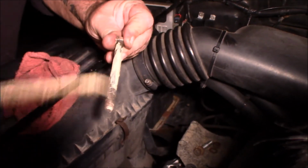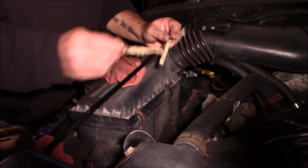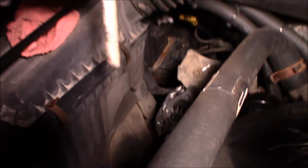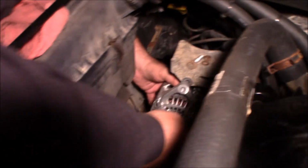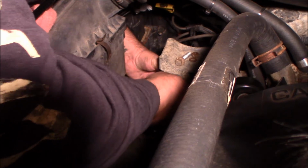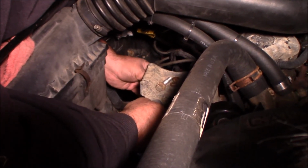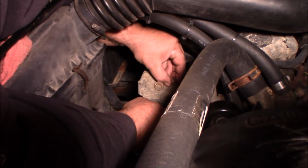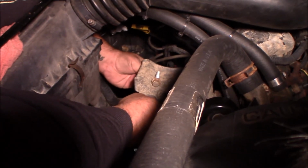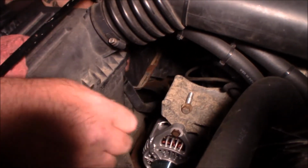and the reason why we use white grease on the top bolt is, those of you who've been watching me for a long time know that line. You know the line, Steve-O? Nope. You don't know the line? Come on, really, Steve-O? I might if you say it. You're going to put some white grease on the bolt. And the reason why you're going to put white grease on the bolt is to make this job a little easier for the next guy. Because the next guy may very well be you. That's the line. Okay. So I got that hand tight.